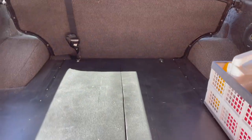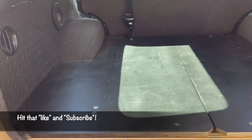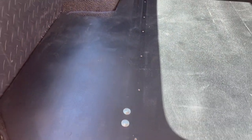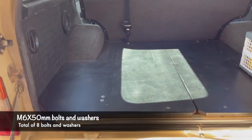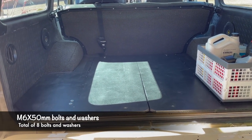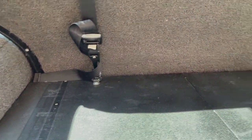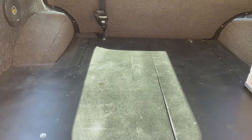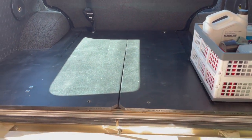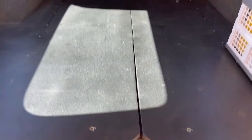In the back I finished my Goose Gear kind of do-it-yourself base plate. I wasn't going to spend $700 for a base plate. It's really easy — just quarter-ply, and these are 10mm screws, about an inch and a half longer than the regular bolts that are in there. I have to keep the rear hooks because of the kids. There are four mounting locations held down with eight bolts total, so it's pretty secure. I did split it in half — it's pretty solid.